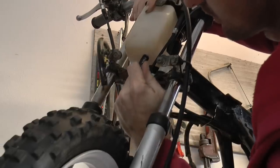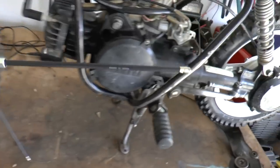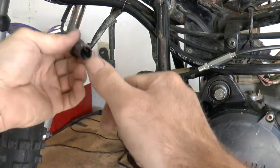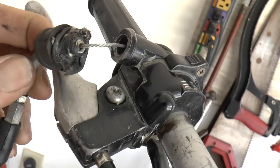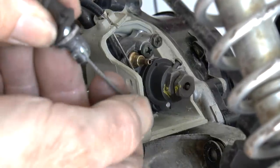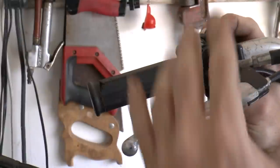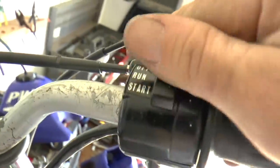The next step is to connect the tank to the oil pump using some ¼ inch fuel hose. My new actuator cable runs from the oil pump down here up to this splitter. There's not enough free play in the throttle cable to bring down this metal disc and make the connection, so I'll disconnect it up here at the twist grip. Looks like we've got a little tape situation. After this is removed, it'll give me enough slack to make the connection, and then when it's put back together, the oil pump and throttle valve will operate simultaneously. I'll put the twist grip back together. I mentioned way back in the first video that the engine stop switch was sticky, so I sprayed some light oil in here while I had it apart. Good as new.